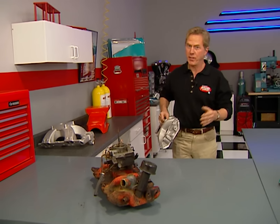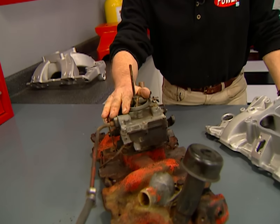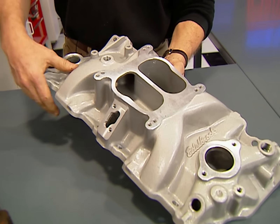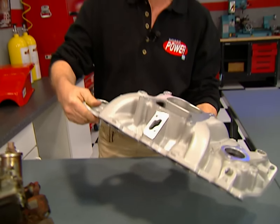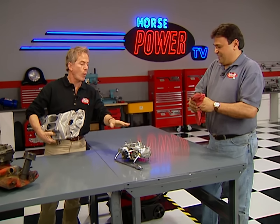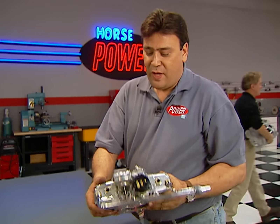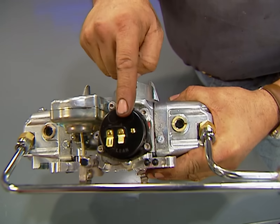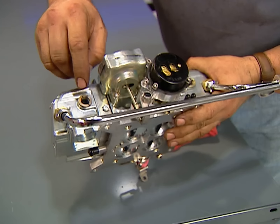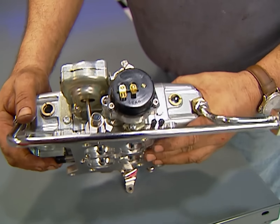That small block's going to breathe a lot deeper with a new camshaft. But using this old two-barrel carb setup would be like making a marathon runner breathe through a straw. So we're going to upgrade the induction by bolting on this Edelbrock Performer — it's a dual-plane aluminum intake, good for low-end torque but capable of making horsepower up to 5500 RPM. We're going to be using a 625 CFM Road Demon carb from Grant Performance. It's got an electric choke and vacuum secondaries for good street manners and good mileage. It's got a clear sight glass so you can easily check the fuel level in the bowls, and each one comes with a chrome dual fuel line.